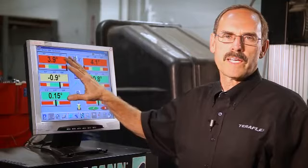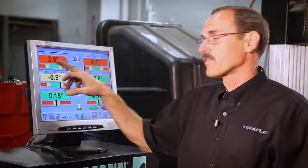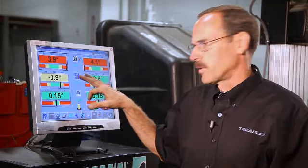We've got our numbers up again. Our caster looks good — we were going for about four degrees and that's what we've got. Acceptable spread: 3.9, 4.1. That looks good. Our camber looks good too. If we had to make a camber adjustment, the only thing we'd be able to do is add an adjustable ball joint to a solid axle — there isn't much we can do with them, but it looks good anyway.